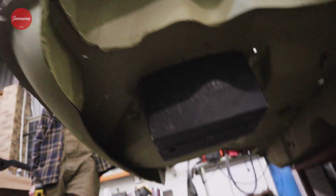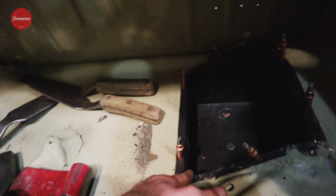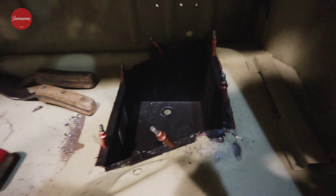So yeah, I'll just kind of go around the car working with a little soft piece of aluminium and a hammer, trying to work that original panel back into fit nice and well. You can see here sort of slowly working my way around as I get to each part, putting in a different Cleco just to hold that shape in place.